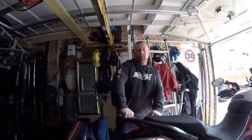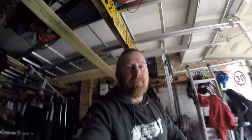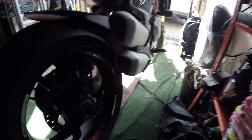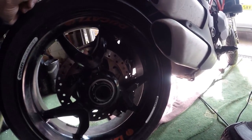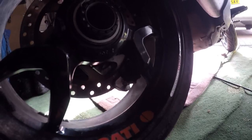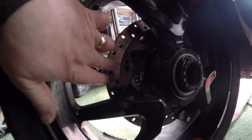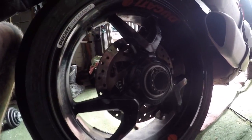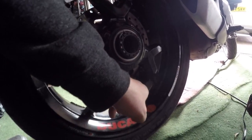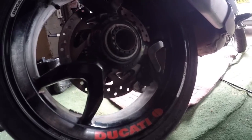I took a quick look at the back brake - I don't think you can get this one off without taking the wheel off, looking at where it is. The back brakes on these bikes are obviously less critical - you've got double discs at the front and much bigger pads. But I still expect better. It was pretty dirty - there was some road salt and grease on there so I've taken that off. But to fully service this one I'd have to move the wheel forward and wiggle it out, and I'm not going to bother because it's the front brakes that are rubbing, not the back.